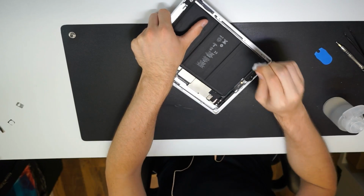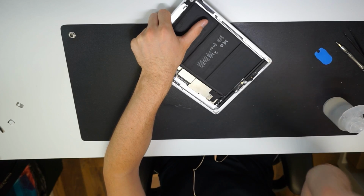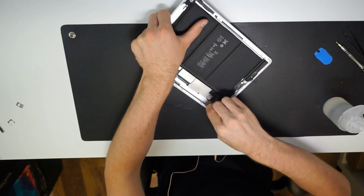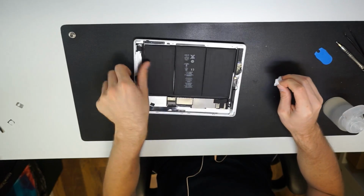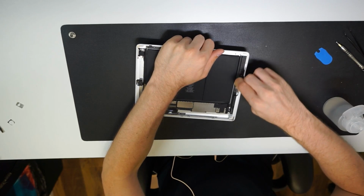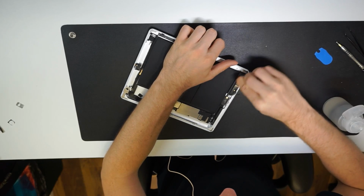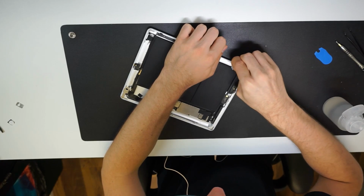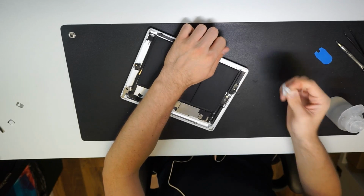Basically, there's a cable that gets pinched, one of the flex cables, and it goes half backlight, and sometimes it goes off completely because it's shorting against the backplate. Plus, they didn't put the two button screws in as well. I asked, "Did you get warranty for that?" He said, "No, they refused to give me warranty. Now it's been sitting there forever." He paid £125 for it, for Christmas.